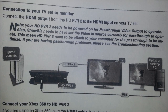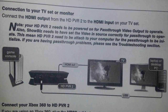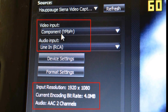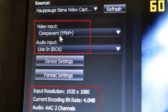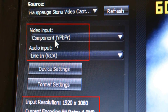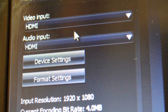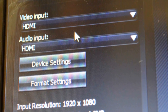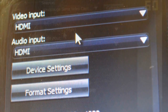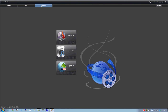Because this is HDMI and uses a switch, unfortunately it needs to be on or initialized for it to work. You will find that when you put your PS3 on with your HD TV on, there is no signal — you need to have your PC on and your Hauppauge HD PVR 2 powered for the pass-through to work. Depending on which console you're playing on — Xbox 360 or PS3 — based on your drop-down choice, that's what you will see when you turn it on.